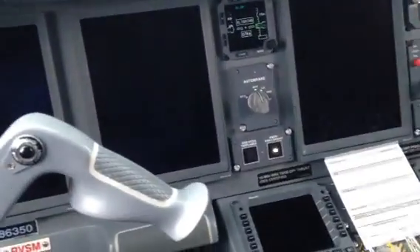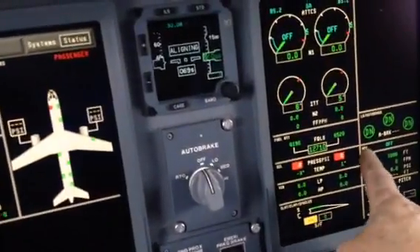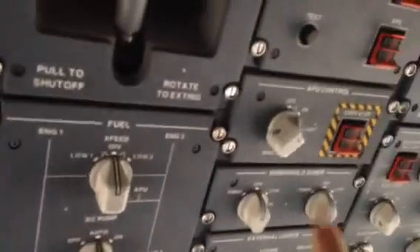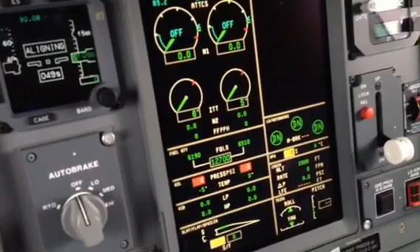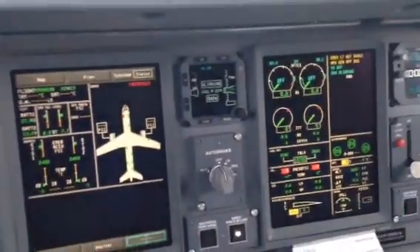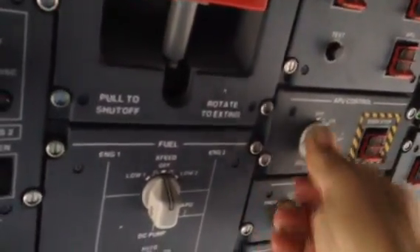So I can at least see the APU — down here is the indication for the APU and you can see it's still selected off. Let's go ahead and select it on. There's the APU selector, put it on. When it gets numbers — you see how it's got blanks here — when it gets numbers it's ready to start. We've got zero RPM and the temperature outside is three degrees. Warning chimes tell you the battery is just charging. Now take the APU switch to the start position, hold it for a couple seconds, put it back to run and leave it alone.